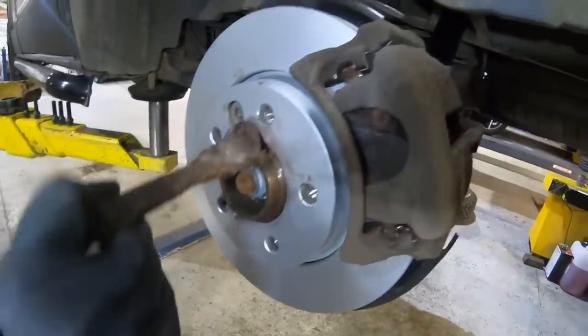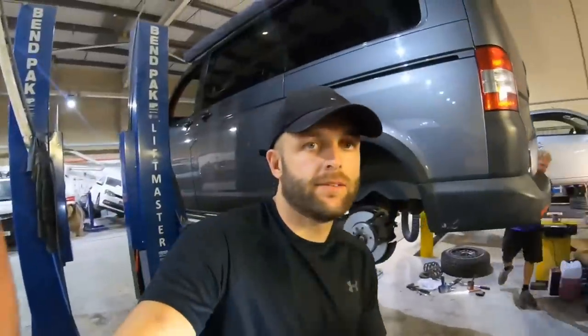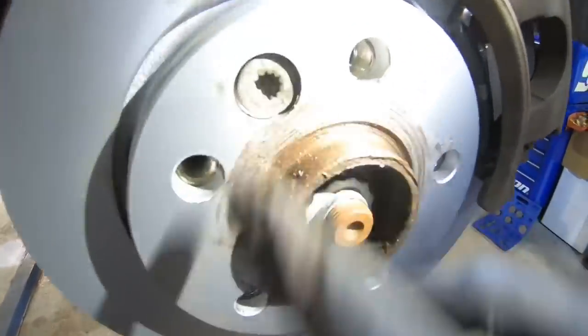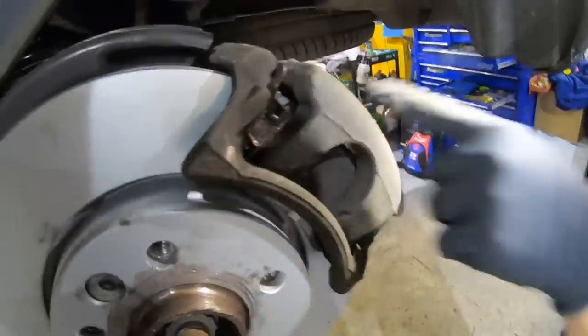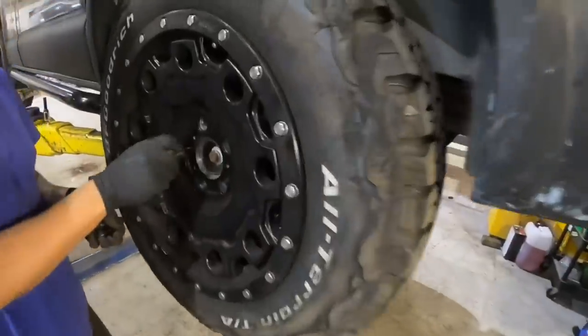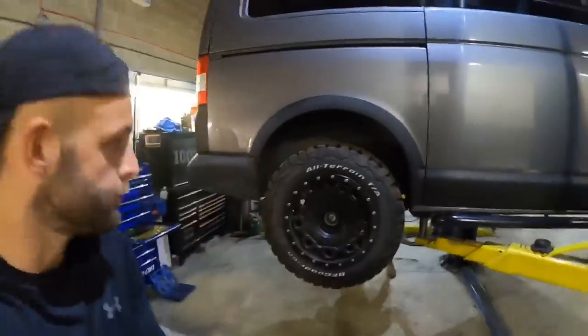A bit of copper slip around the hub - make sure the wheel slides on easy. Right, the wheels are ready to go back on now. That's the discs and pads done on this side - we're going to do the other side now but I'm going to skip recording that, it's exactly the same procedure. Right, quick recap: disc on, grub screw tight, carrier tight with the two 21 mils, pads in, caliper back on with two 12 mils tight. Discs, pads, carrier, caliper all tight and ready for the wheels. Both discs and pads done, shocks and springs done - putting the wheels back on, going to lower it and give it a road test.